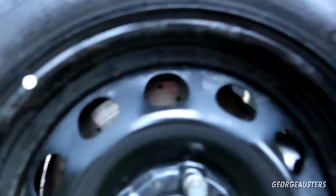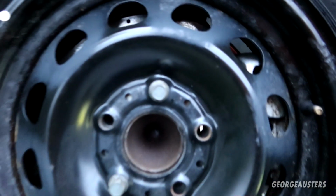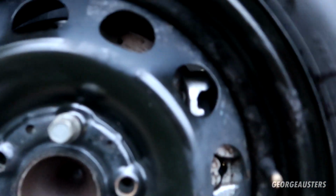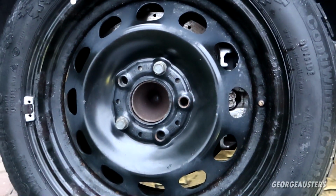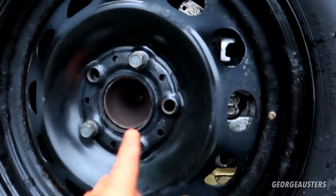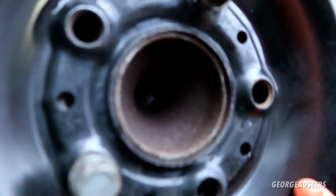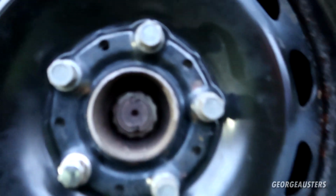Wheels don't fit on the front. Obviously, front brakes, bigger calipers. The wheel doesn't go on all the way, it just rubs up against the caliper, and yeah, not good. I think we're going to need some spacers, either 10mm, 12mm or 15mm. You can see it just doesn't want to go on all the way, whereas this is how it should look.